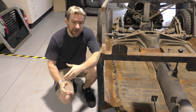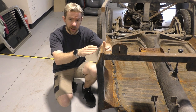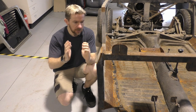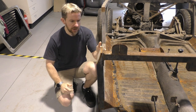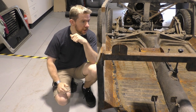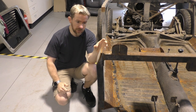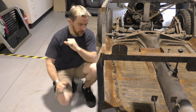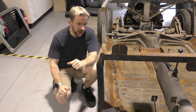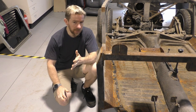In the previous build episode, I did mention about these front arms here flexing outwards, and when I had these tightened up, the A-arm that went underneath the machine was getting wedged. As you can see, I haven't tightened these bolts up. You can see daylight right through the centre. This here needs to have a bit of packing behind it in order to stop that so it doesn't pull in. It's okay to have a bit of pull in, but when it's causing a pinch on the A-arm at the bottom, there's definitely something not right.